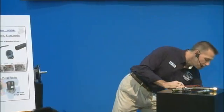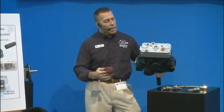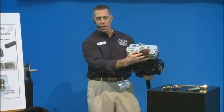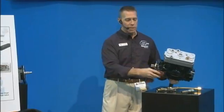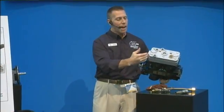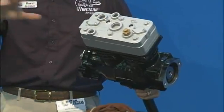The first thing you're going to want to do — and really not much better than the old soapy rag — is go over the compressor head and the fittings where all the connections are, just to make sure there's no air leak, nothing obvious like coolant or oil or anything like that. And again, all the lines you want to check.